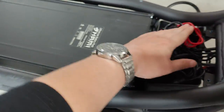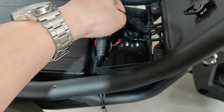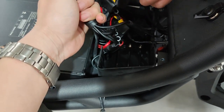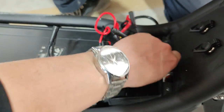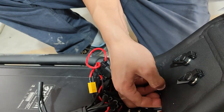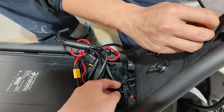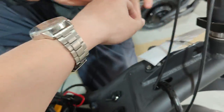Once you open the deck, remove the foam. Then remove some of the cables out. Locate these two connectors for the cable on the top. If you have trouble disconnecting them, you have to heat them a little bit. Once loosened, you can pull the cable out one by one — there are two cables here. Be slightly gentle and give a push. The cable is out from the frame.